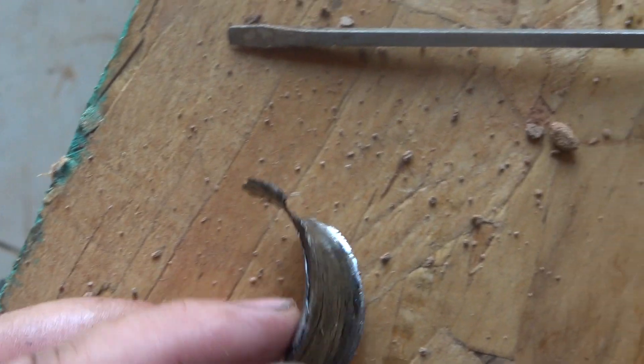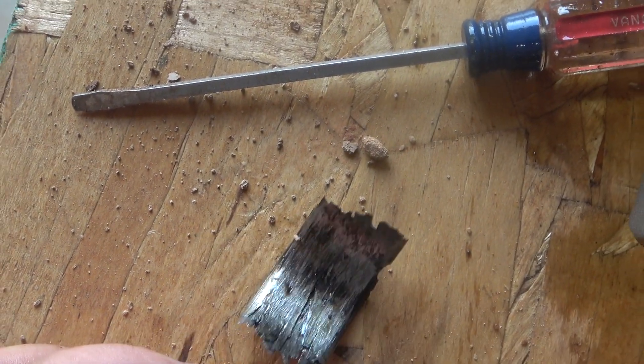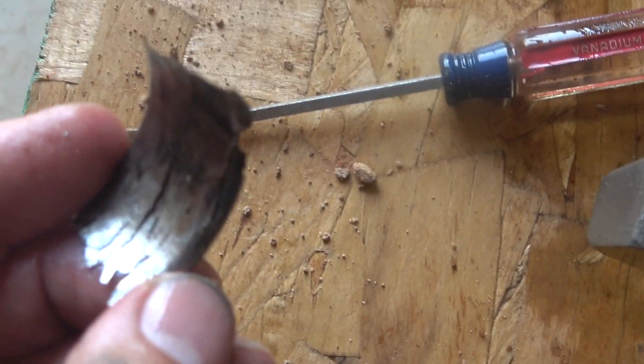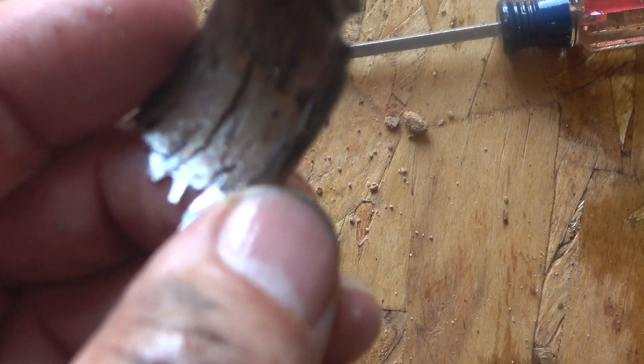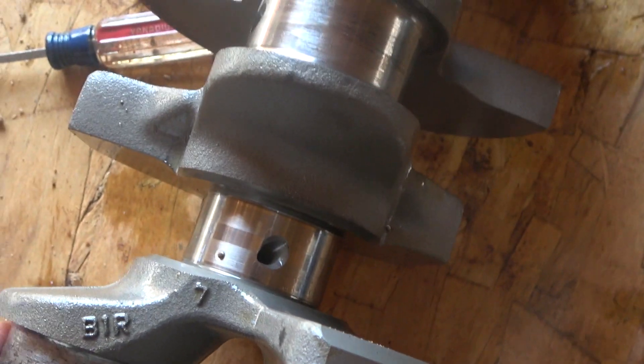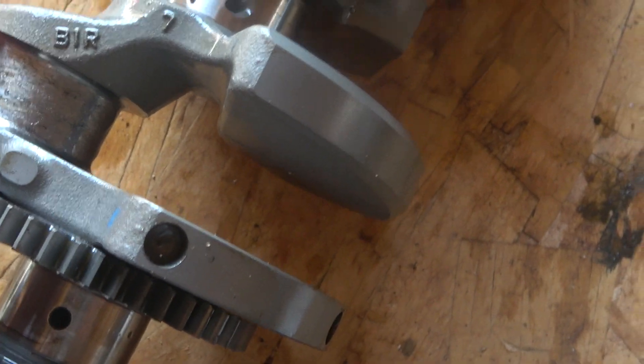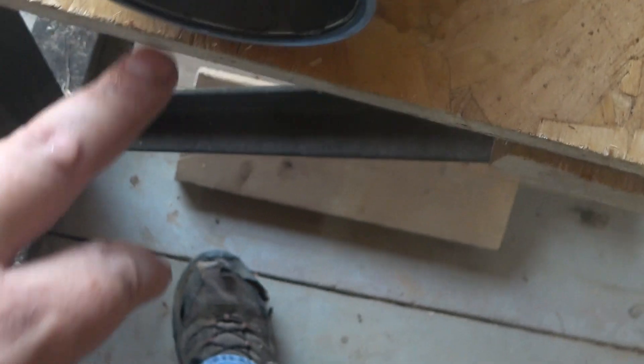You can see it's just completely toast — both of them melted together. You can see multiple layers of metal. This part of the crankshaft is toast. You could possibly have it machined, but a new crank I was looking at was $500. I still haven't taken off this side or the clutch on this side.